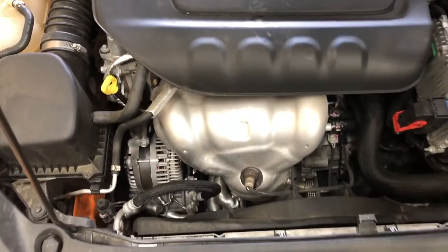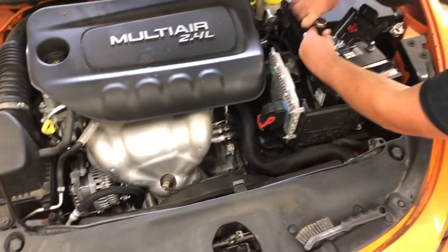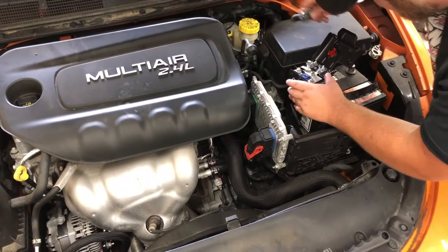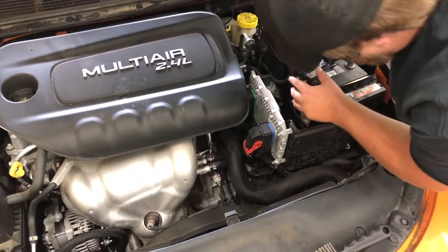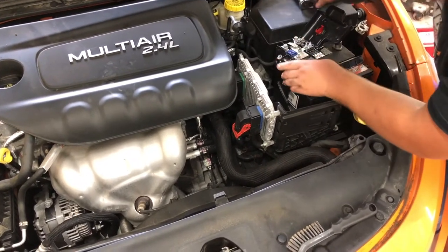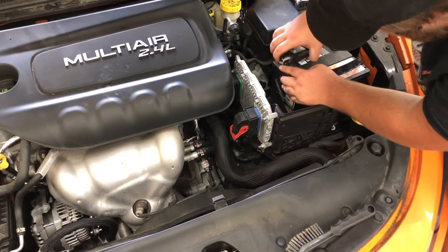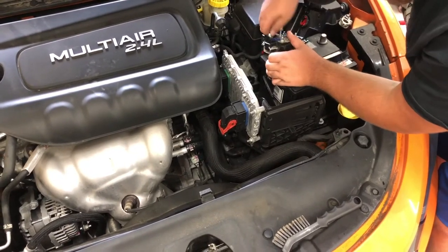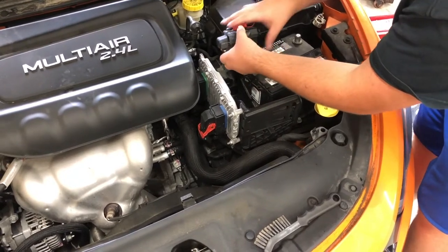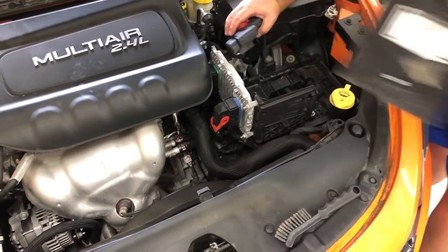So we were looking at the alternator, and we're gonna get cracking on it. The first thing Caleb is doing is taking out our makeshift battery that we were trying to use to get this thing running to move it. It's all 10 millimeter bolts or studs that take it out. Yeah, it's the thing on the left. That other one does nothing, I don't think. He's loosening it all so we can pull the battery out. Even the battery hold down is 10 millimeter if you have to pull your battery, which in our case we are now, because we put a different battery in it.